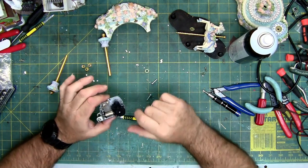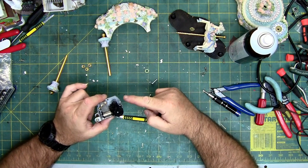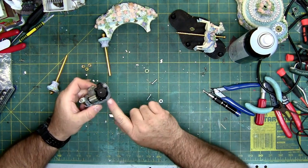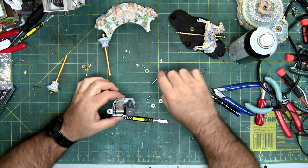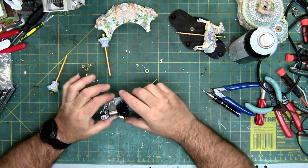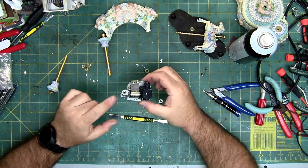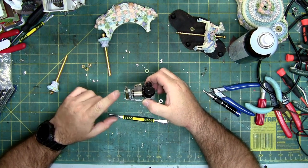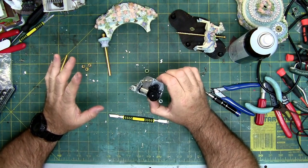If you work on a music box center, the spinning centrifugal weight, if you touch it or hit it, it slows it down or stops it. Then of course the key rotates with it, so if you put this down, it's trying to turn the key, which is sitting on it. But that's gone up and down one complete revolution. It's on its way back up again. So I think we got this one fixed.